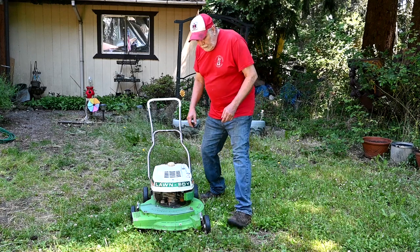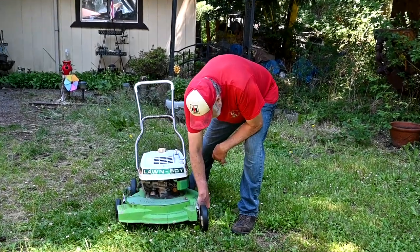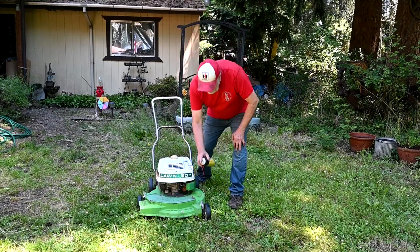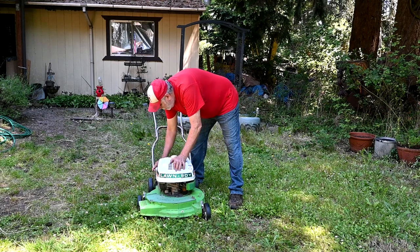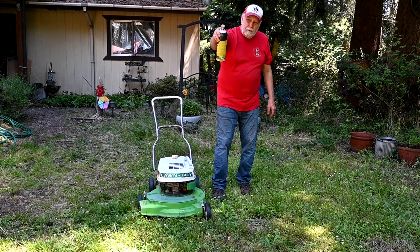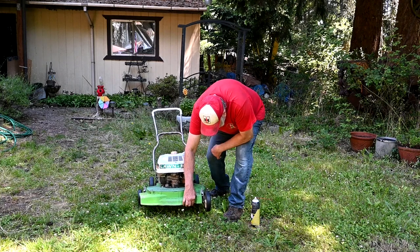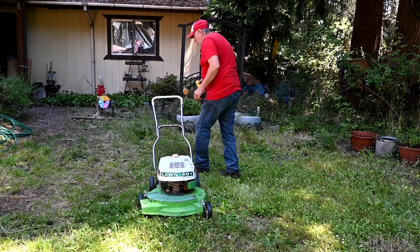And then the wheels, when I get them ready to come out here, get a plastic hub. You can see these spin nice and free. People don't lubricate them, they just wear up. So I use chain lube on them, motorcycle chain lube. Put it down on the hubs here. The reason I use that is it goes on like an oil, and then as it sets up, it turns into a light grease. So you can put it on the hub there, spin it, and you can just see how nice that is. It lasts for a long time. So anyway,